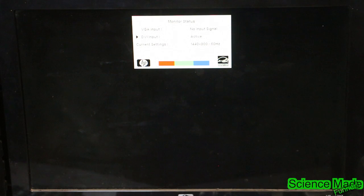Now we're going to actually install the software. One of the most important things about installing the software is patience. Plug the USB into the back of the computer directly into the motherboard, not a USB on the case because those can be slower. Also, you need a wired keyboard — wireless ones don't always work. To open the BIOS on my computer it's the Delete key, but check your motherboard manual to see what key it is.